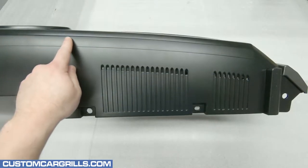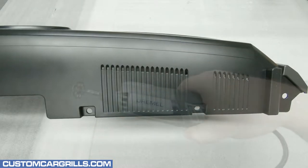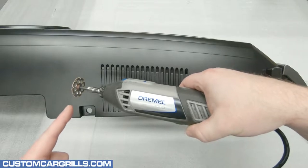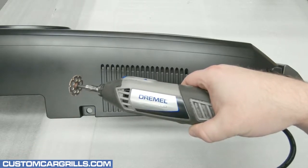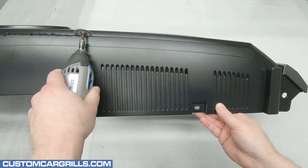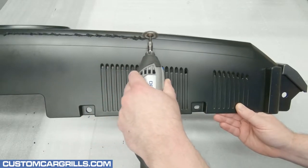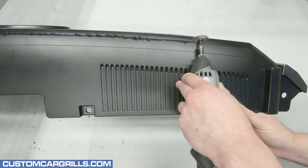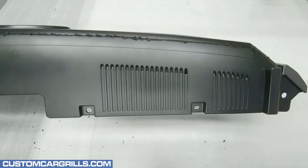There's a bit of cutting that needs to be done, and the first cut is along this top edge. To make my cuts, I like to use my Dremel and equip it with the number 543 cutting and shaping wheel. A good steady hand will make for a clean cut, as well as having someone hold the grille still so that it doesn't move while doing the cuts. I'm stopping a little short on the corner because it takes a sharp turn near the end.